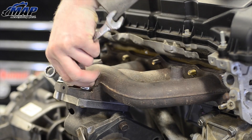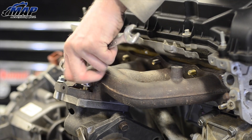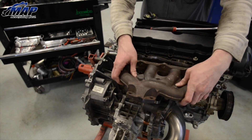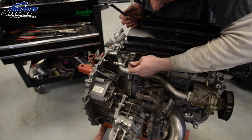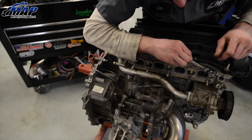Repeat for the second back bolt. If it is stuck, soak in penetrating liquid like WD-40 or equivalent to break it loose. Re-loosen and remove the front two nuts. Remove the old manifold by pulling up and away from you. Remember to pull off the old gasket. Remove the top two outer studs using the same double nut technique from before. This will complete the removal.